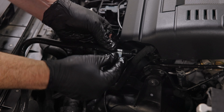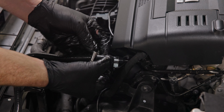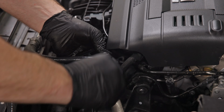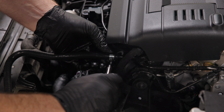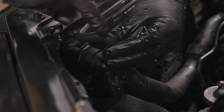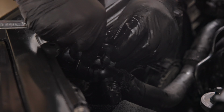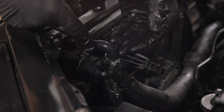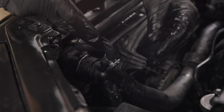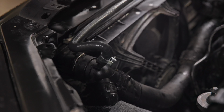We're going to start by tightening the upper clamp first. Make sure it's slid all the way over. You can feel where the hard line is. Now, before tightening this lower one, make sure that this is orientated correctly. If this hose is too far in either direction, you risk rubbing the hose with the new heat shield on your intake. So we're going to want to put it perfectly straight and then just turn it a little bit with the driver.